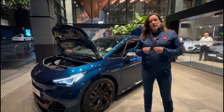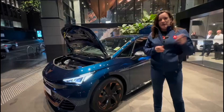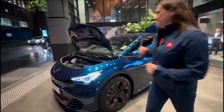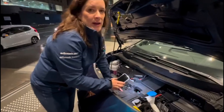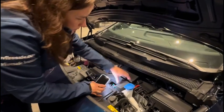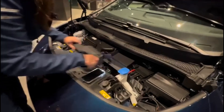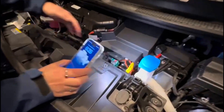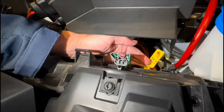To isolate the vehicle, they've actually got three isolation points for emergency responders. Let's have a look at the first one in the front. Under the bonnet here, there's what we refer to as a pull plug — just in under this bit of cowling here. I'm going to pull that off. And you can see there, it's got the yellow emergency responder label.